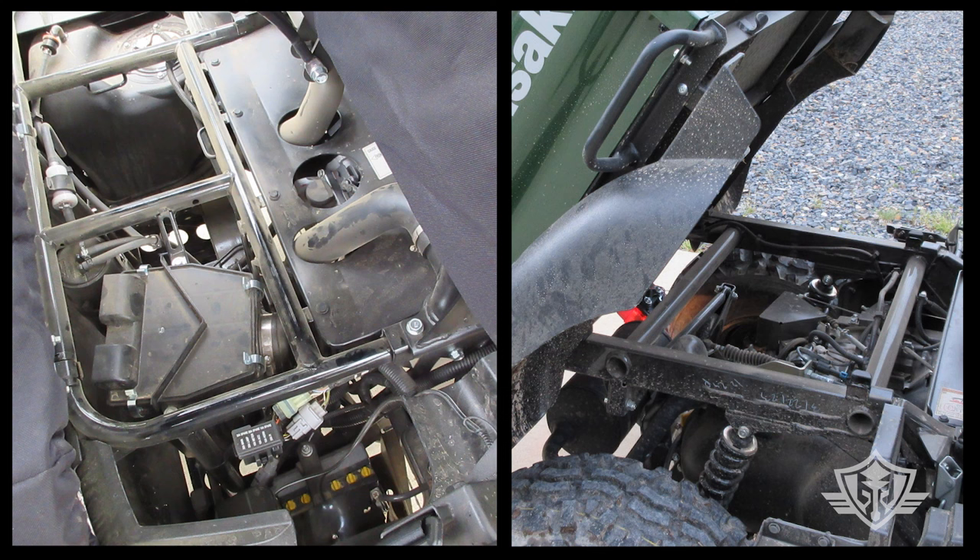Good thing this little guy is slow enough that you could probably just do a Fred Flintstone stop with your leg if needed. Another thing I notice is when you're descending down a steep hill — sometimes the centrifugal clutch stays engaged and you get good engine braking, and other times the clutch will disengage unpredictably and it's not easy to tell when that will occur. This is not uncommon on a CVT transmission, but combine the weak brakes with unpredictable engine braking and you could potentially have a dangerous combo on a steep and technical descent. Also, the tight cabin and the pedals being way too close indicates to me that this machine was probably designed by a team of 5'4" engineers from Tokyo and not for the benefit of 6'2" guys in the USA where this machine was assembled and sold. I can only handle short trips before my cramped pedal leg starts cramping. They could have moved the pedals forward quite a bit more.